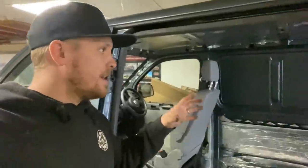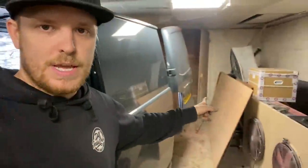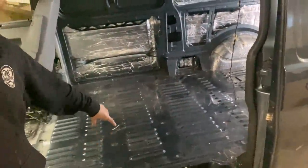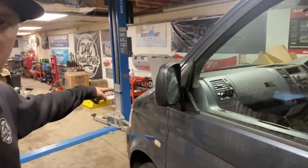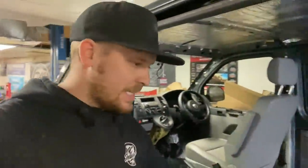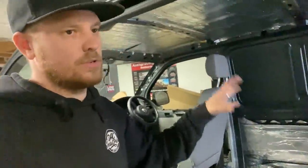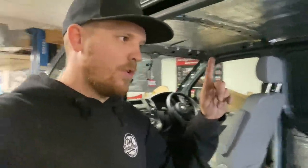That's pretty much me done for the day. We've got those bits done and I've been and picked up a sheet of 9mm ply which I'm going to cut some rips out of at my brother's in the morning — those bond to the floor. We've then got in that box down there the 7mm insulation that goes on top of those ribs on the floor, and then your 12mm ply goes on top of that and screws down. Then we've got an insulated floor, insulated walls, and an insulated roof.